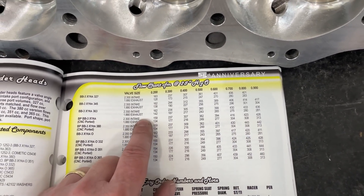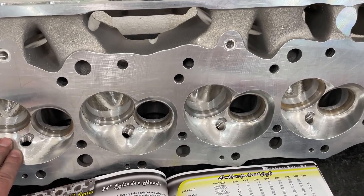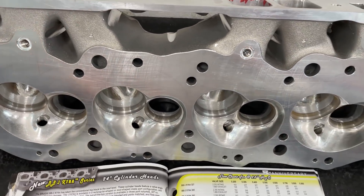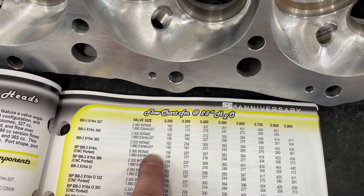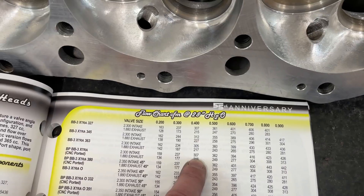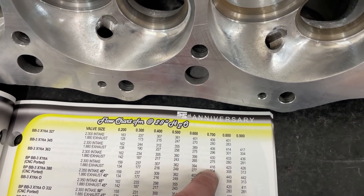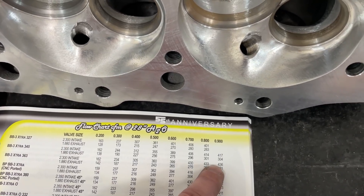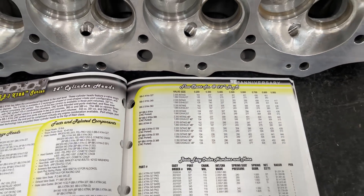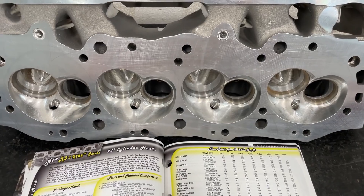For the record, I'm just helping you guys out in case you're wanting to save some money. This is the 366 - they make an as-cast version of this head, the 363, which has a CNC chambered bowl blended in both intake and exhaust, and CNC gasket matched on the intake port. If you look at the flow numbers comparing the two, it's not that much slower. You're looking at 307 to 305, 360 to 362, 399 to 394, and at some points the as-cast was actually better - 430 to 416, 433 to 423, 436 to 426.